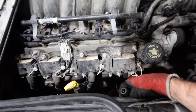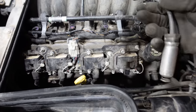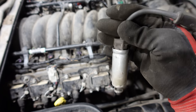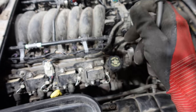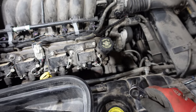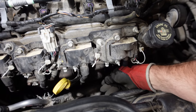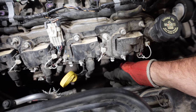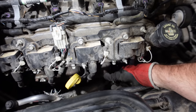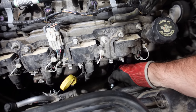So the problem coil — pull the wire off. We'd already had the wire off before so it came right off, though some of the others do not come off easily. A visual inspection of this wire doesn't show any real problem. It looks like an OmniSpark based on the color — pretty easy to tell when it's an O'Reilly's wire. The plug in there looks like it might be a little bit new, which is already scary. Got that spark plug loose and we're getting it out now, hopefully it shows a failed electrode or something crazy.